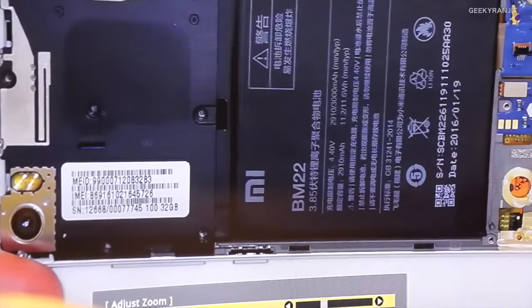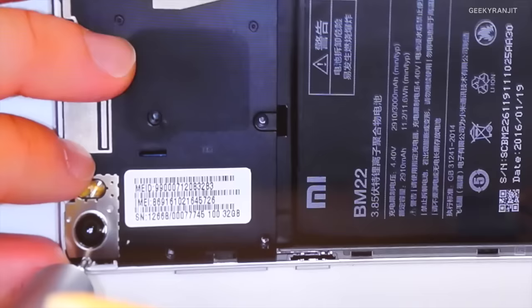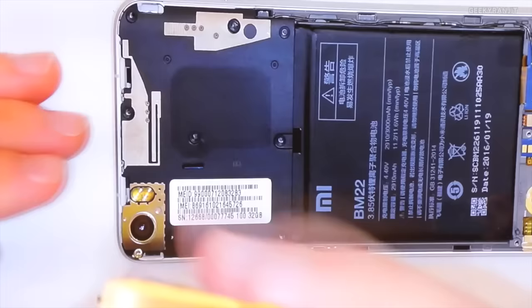All right, there's one other screw left here, which is this guy over here, and I'm told this is a non-magnetic screw. The reason being, it's too close to the camera, and because of the OIS motor, if it was a heavily magnetizable screw, it could potentially create problems. So I actually can't pick it up with a magnet on the tip of the screwdriver, so I actually have to take that out, maybe.